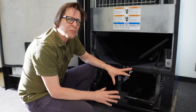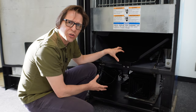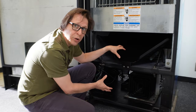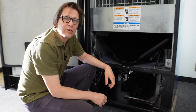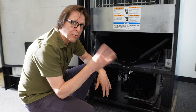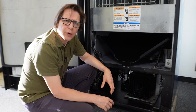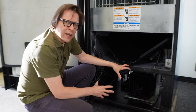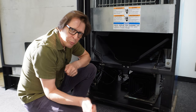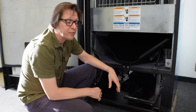For the first-time vendor, this may be a bit confusing, but the good thing is everything on this vending machine can be serviced from the front. This whole unit can be slid out from the front once it's been disconnected and unbolted. This can be done with only three sets of tools, and usually within 15 minutes. In this video, I'm going to take this compressor out of this machine and put it back in so you can see the whole process step by step.